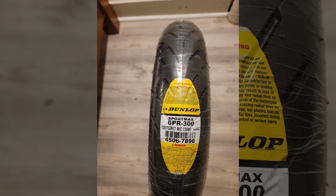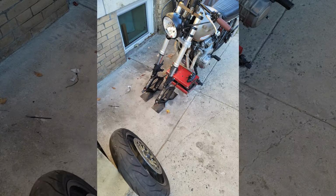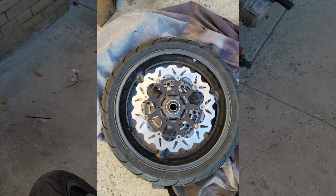And finally, a new front tire to allow me to put all that braking power to the actual pavement. I wanted to start with the rotor on the side that appeared to have the issue. So you can see how the brakes are pushed back when the wheel rotates, causing the rider to have to pump the brakes to remake contact before braking actually happens. I noticed it on this rotor, so I replaced this rotor first.